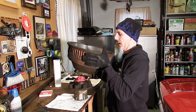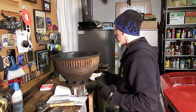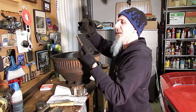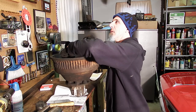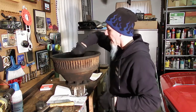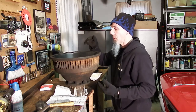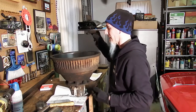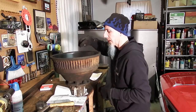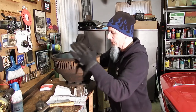We're going to lift this up — it's a lot lighter now — put it back on here, and press the studs in from up here. Now that it's cleaned up, we'll take our studs which I soaked for a bit and cleaned up. I didn't have a die that big. We're going to get these started in here. They can be pressed in with a press, or you can just hammer them in with a drift pin — just make sure everything is centered. I'll also show you another way to get these seated. If this goes easy enough, I won't do it that way. But you definitely want to make sure it's seated down all the way.